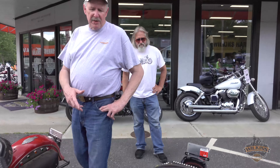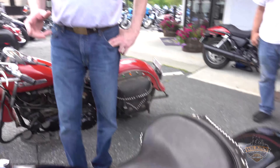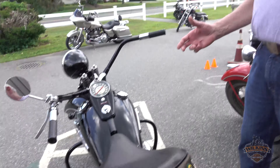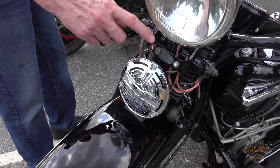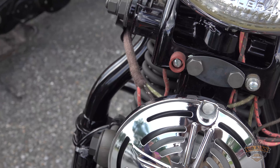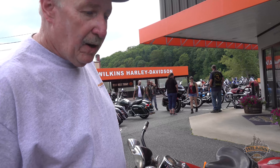The next motorcycle belongs to my friend Bob Provencher. This bike is also an FL model, 74 cubic inch 1200 CC, and as you can see it has more chrome on it, which was starting to come into vogue and availability after World War II had finally ended and material was now offered to motorcycle manufacturers. Bob has the rosettes on the seat, the deluxe seat, and chrome rims. Intrinsic to this 1946 and later is the shock absorber versus a ride control, and both of these bikes have it — it was actually an option in '46.